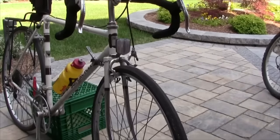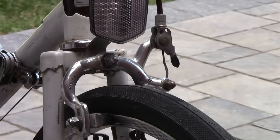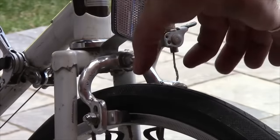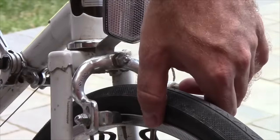This one here is a much older style of road bike and the brakes look quite a bit different, but much the same — it's very easy to disconnect. It just has this one little handle which all you have to do is pull into the upright position, and again the pads just move open a little bit, because it really only needs a little bit to be able to clear the bulge from this tire.